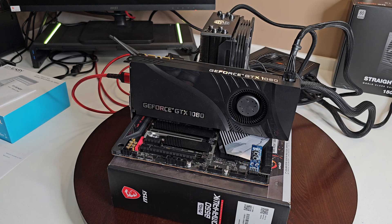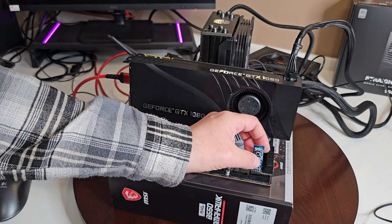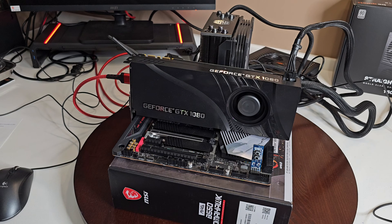I have a keyboard and mouse hooked up. I'm going to hold down the left Shift key and restart to see if it takes us into the troubleshooting steps. That did not work. If you want to follow that though: hold down the left Shift key, go to the advanced startup menu, go to Troubleshoot, Advanced Options, System Restore, select a restore point and click Next to restore. Hopefully your PC will work. Scenario one did not work, let's move on to scenario two.